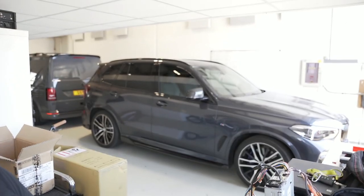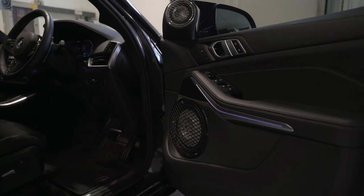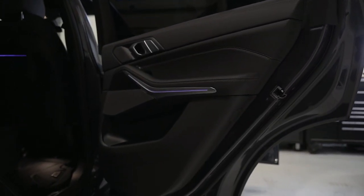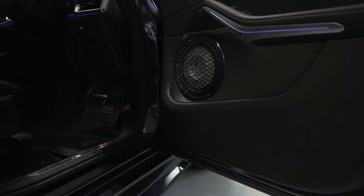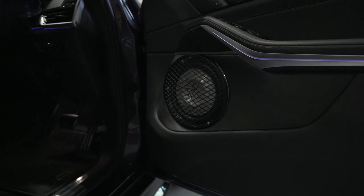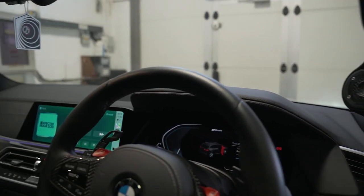Front end first. If you own one of these you'll understand that whilst it looks really OEM, it's extremely different. This is more what the standard pocket looks like, and that's what our new door build looks like. This build is a sealed enclosure — an eight-inch Focal Utopia mid-bass goes down into the door with tons of space in there, very nicely built and braced, really solid. Then a mid-range enclosure opening to the door — sort of an open baffle design — and the tweeter build on the pillar.